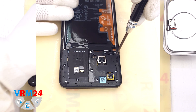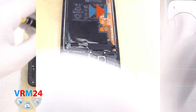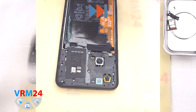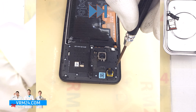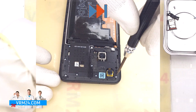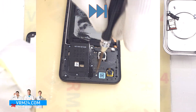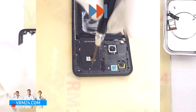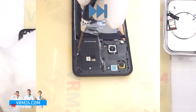After that, we move on to unscrewing the screws. For this, we use a Phillips screwdriver 1.5mm, also known as Phillips #000. It is better to place the screws on a special surface in a certain order so that we don't confuse anything when reassembling. If the screws don't come out well, we can use a magnetizer. If the screws get stuck, we can use tweezers.